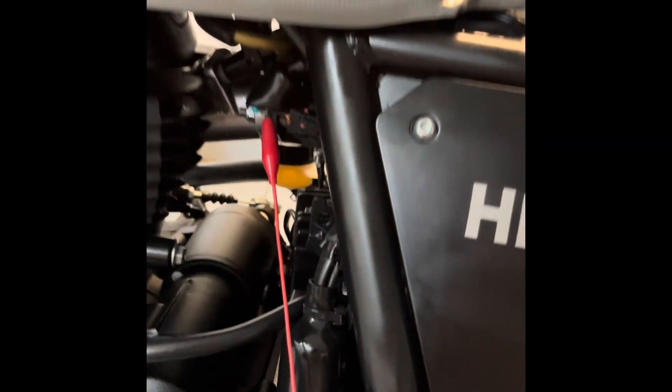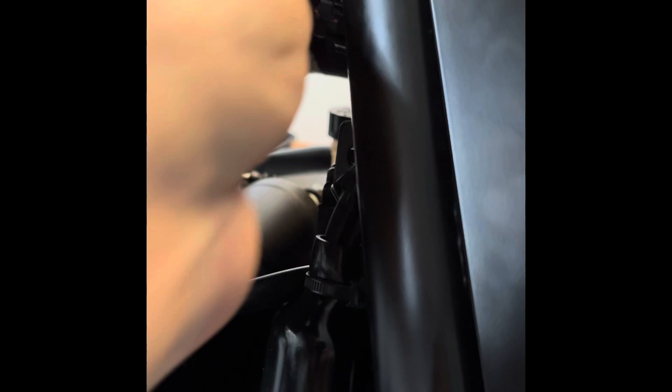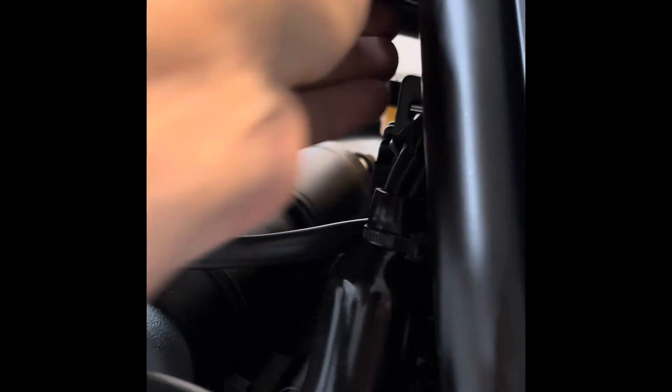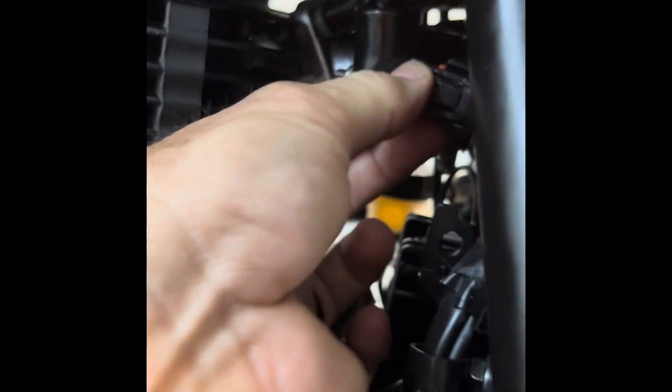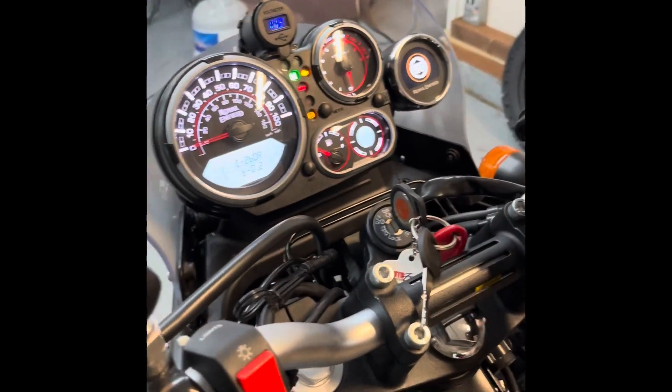And that's really all there is to it. Turn your key off — hopefully your battery is not dead. Take your alligator clip off, take your pin out, put your boot back on. When you put this back on, make sure it clips or clicks when you push it on. Get some of this tape back down over the wires. Now the TPS is set a little bit higher — let's see if it'll start. It hasn't been started in two days.